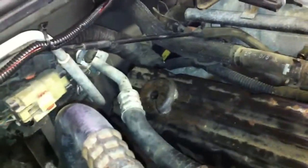Right now I have all the spark plugs in. This valve cover has to come off because part of the PCV valve fell into that grommet, which I tried to get out and failed. So got to get a gasket set and that grommet, and then put it all back together. The computer is out because it has failed, so we got a new one on order. Should be here next week.